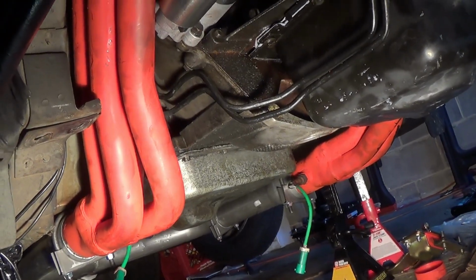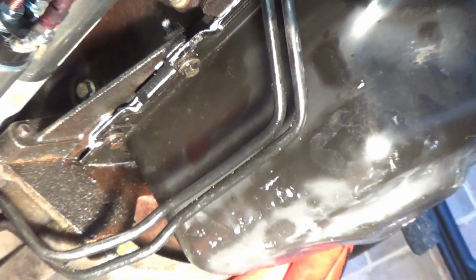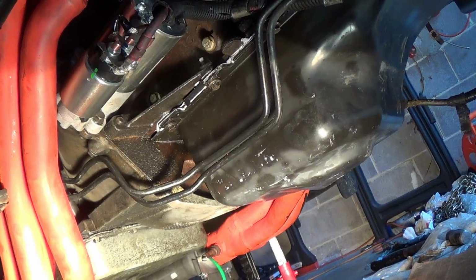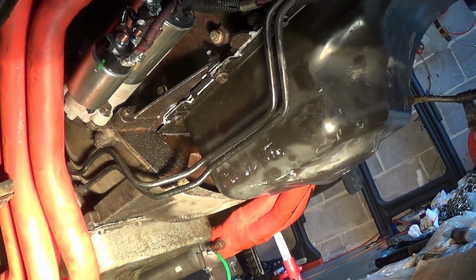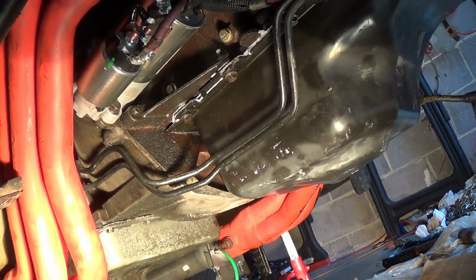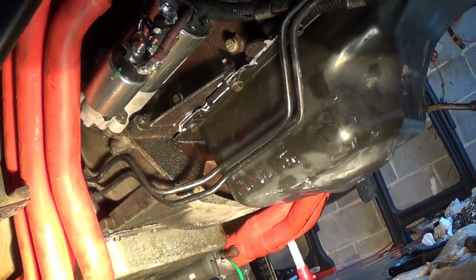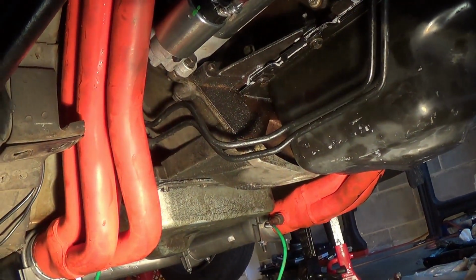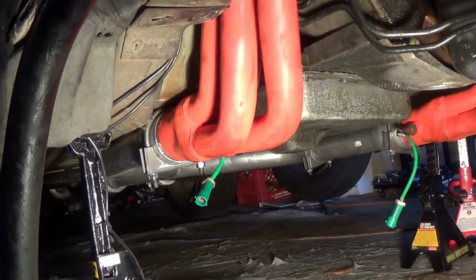And we got to get oil, because remember we changed this valve cover gasket, so we have no oil in here. So we got to get oil and an oil filter. That's no problem. I'll probably get that sometime next week, but I don't want to put the oil in and it drains out, because it's going to come out where the dipstick's supposed to be. So we got to wait to put the oil in, and we got to put coolant in here because we lost coolant when we changed the seal on that piece. So with this all said, it's gonna be a little while, y'all.